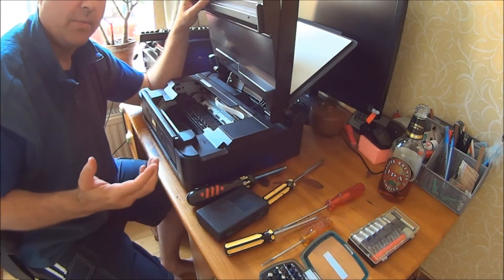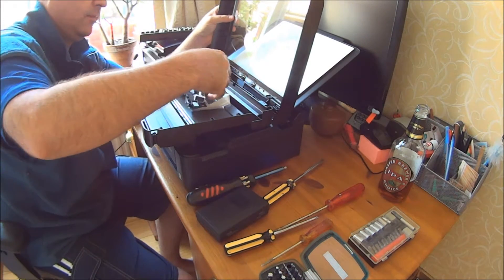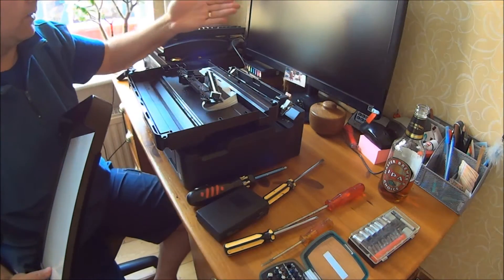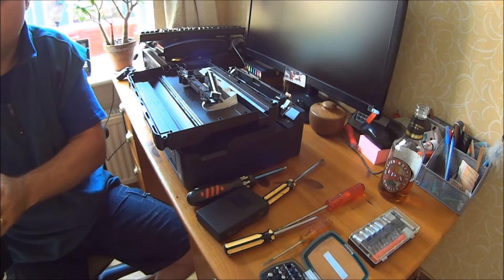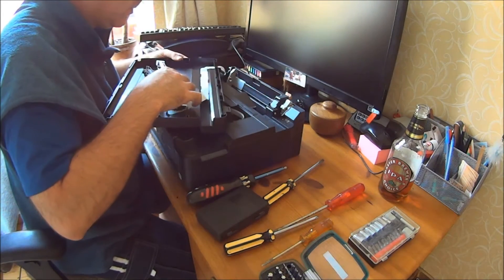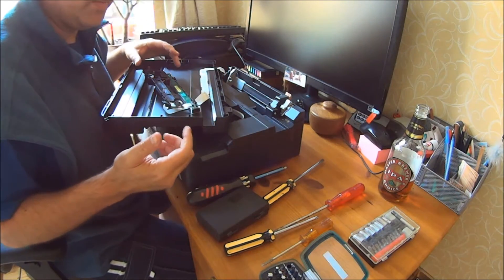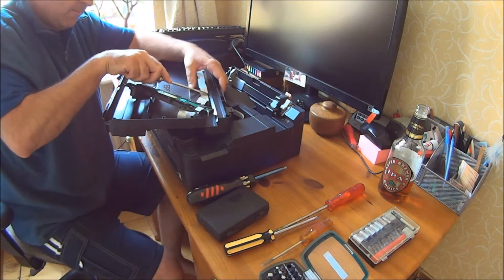I think you just have to accept that sooner or later something's going to break. We got that off and I didn't destroy my monitor, which is a good thing. I'm going to get the glass out of there a little later. One done. So the ribbon is held in place with some retaining lugs which I might be able to get around, but I might damage the ribbon and I'm not sure I want to do that just yet. So what I'm going to do is break off the lugs like that.